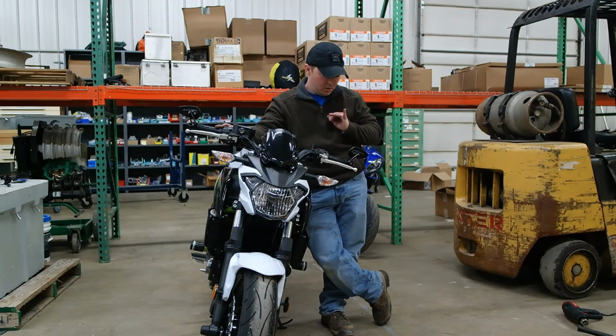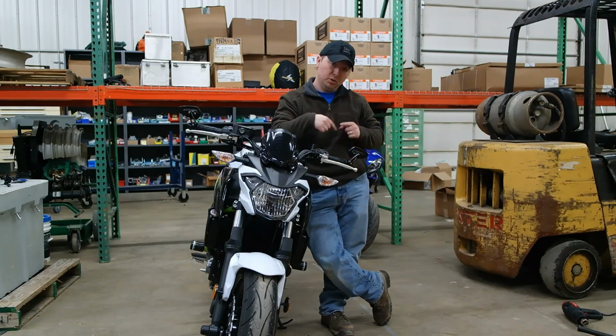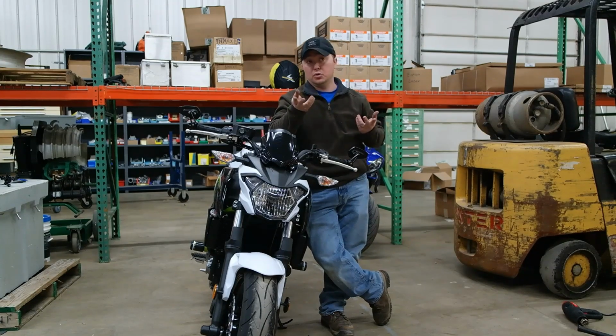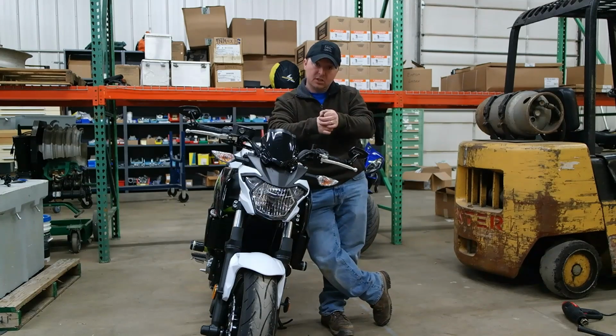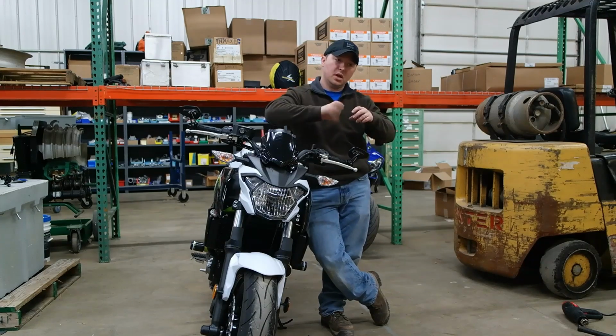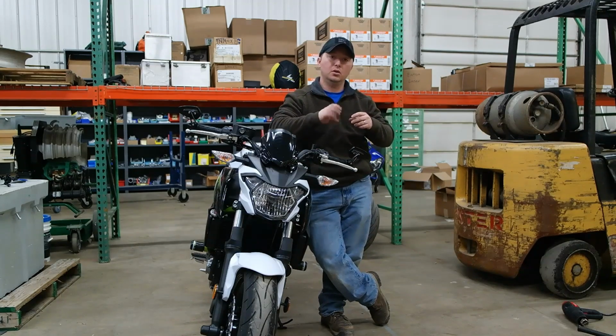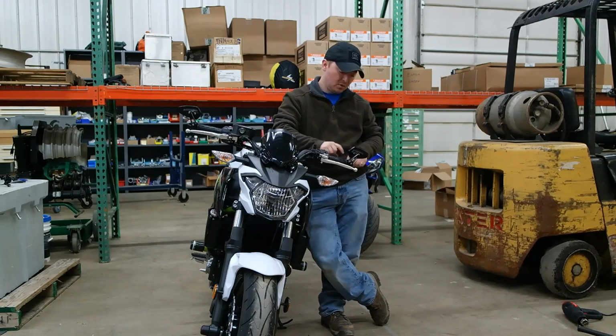It's great for that. So we put the plastic bushing, we wrapped a little bit of electrical tape or anything that you've got. What you could do is you could also split the PVC if you wanted to make a little gap, so when you tighten this down it really seats down. The gap's not too awful bad to be tied on the factory bar end. There's different ways you can do it. You just don't want that piece of plastic freely spinning on it. You want it to have a little bit of resistance, so when you lock this down it squeezes everything together.